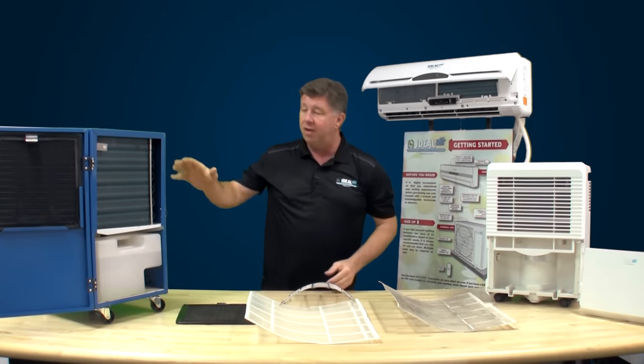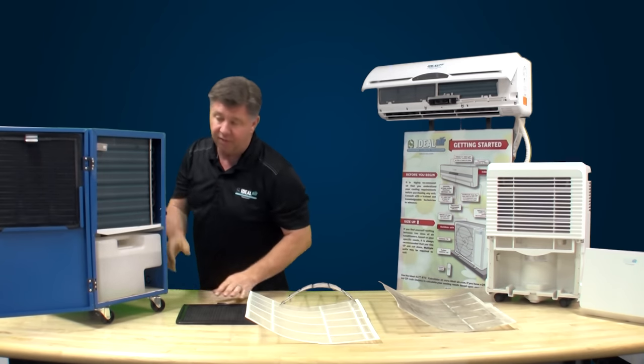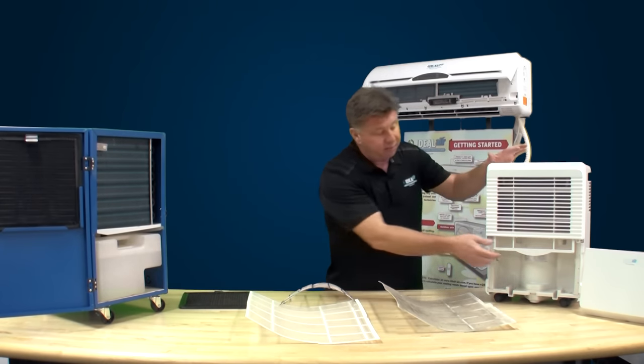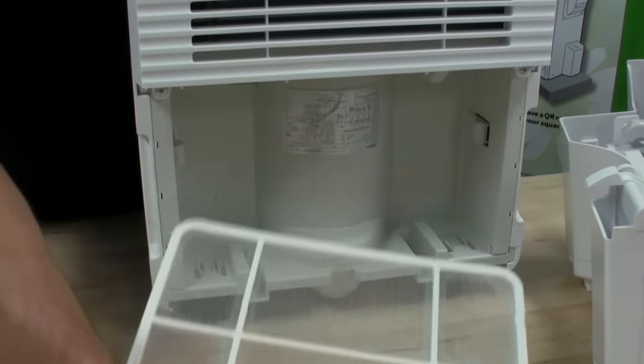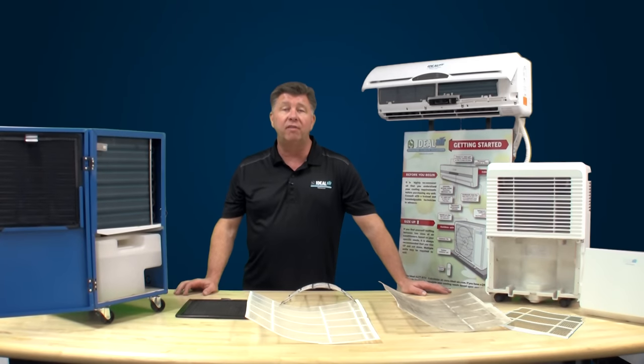You can also use a garden hose to hose these filters off — it's probably the simplest way to do that. Also important are filters on the dehumidifiers. All the dehumidifiers have filters you can see in the front, or slide-out filters in our 30, 50s, and 70s that should be serviced. We recommend that you clean your filters every month to keep these things running efficiently.